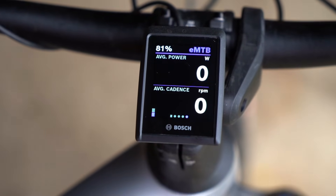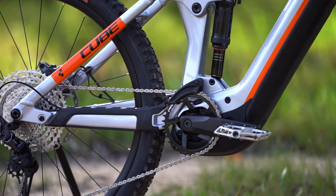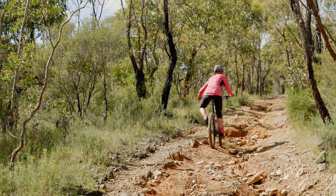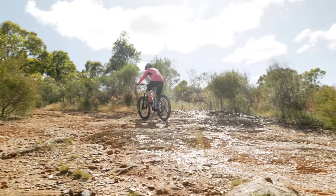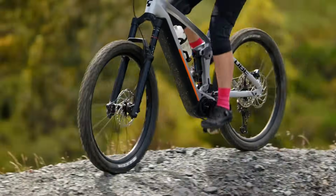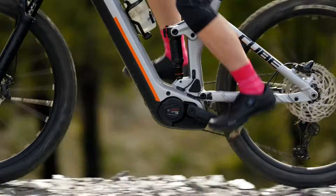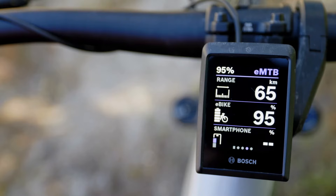Number seven is cadence. One of the most impressive aspects of the Bosch Performance Line CX motor is its ability to provide power across a wide range of cadences. Regardless of gear choice, it has a remarkable amount of grunt when you need it. The downside is that it's easy to lean too much on the motor and continue riding in too high a gear. This has a negative effect on drivetrain durability and places unnecessary strain on the motor's internals, while also reducing overall efficiency and draining the battery quicker. Ideally, you want to pedal with a cadence of around 80 to 90 RPM. This provides optimal support from the motor while maximising efficiency and reducing load on the drivetrain. A good idea is to display the live cadence reading on the Kiox 300 head unit — there's also a nifty colour-coded meter which shows you when you're in the optimal range.